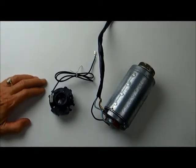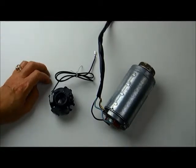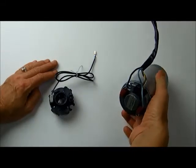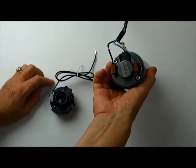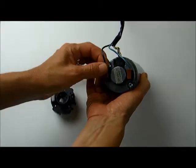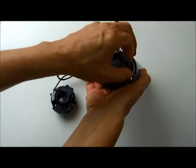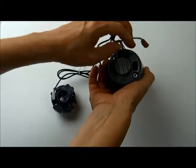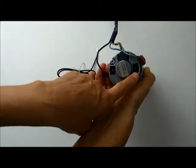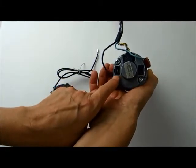In this step we're going to determine whether it's necessary to change the black wire on your old motor. Older LawnBots had a different connector style than the new brush kit. Take the connectors off your motor — pull on the connector, not on the wire — and you can see that the two tabs, which are inside the old brush kit, are identical in size.